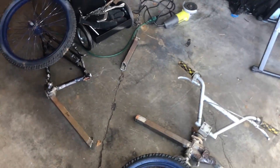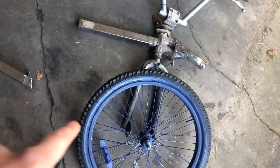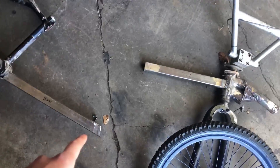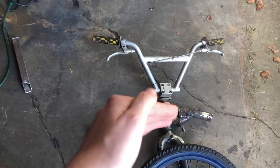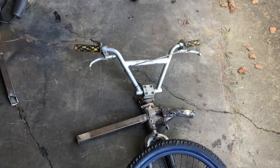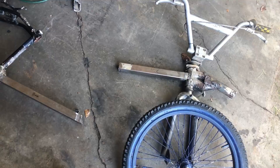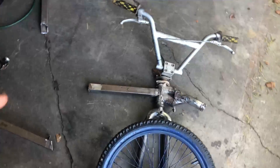I was wanting to kill two birds with one stone anyway, because the air gap that was between the wheel and the frame here — I did not like. So I think it was something roughly like this where we're going to have a bar similar to that, but just a little longer, and then pitched up more so it can make the rake that we want. In my CAD drawings that I made adjustments to, it was about 14.27, and the measurement there was about 14.5, which sounds about right.